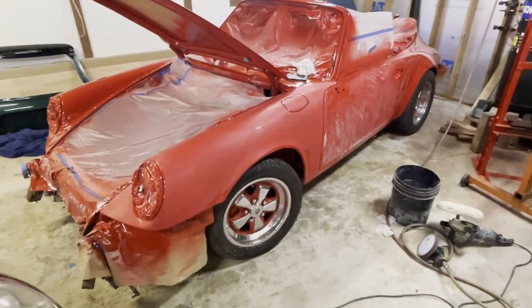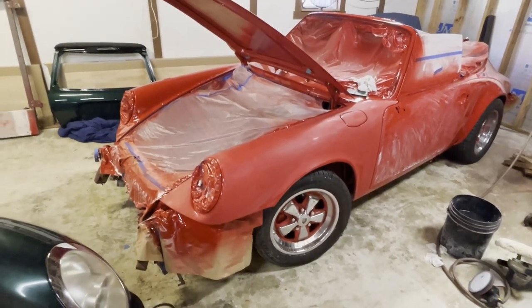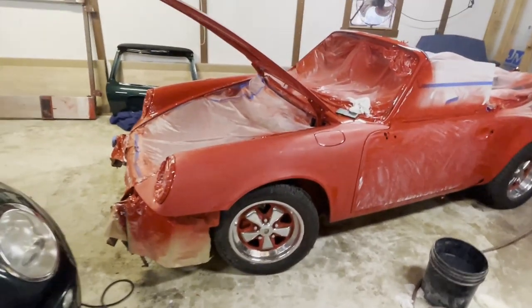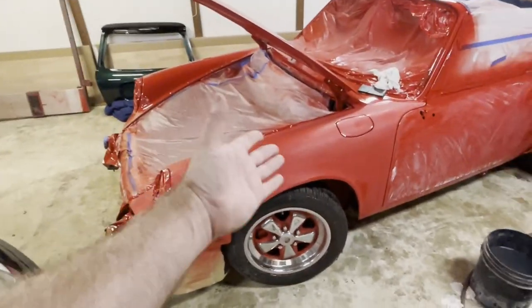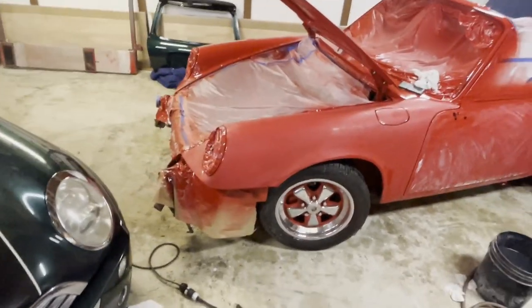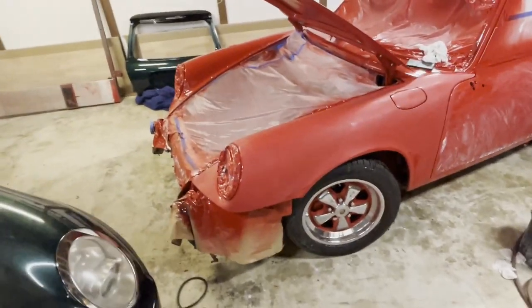Okay, so here is our fender, and it has been sanded down completely with 1500 grit. Most of the orange peel is gone. So the next step is to use the buffer and buff it and see how it looks. After buffing, we can then decide if we are getting the orange peel removed to the level that we wish, or if we should be sanding each panel more.